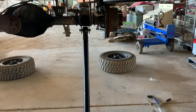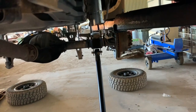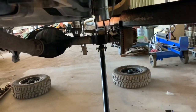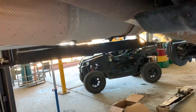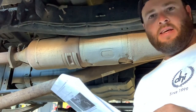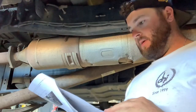This bracket's all in now. I've got this traction bar just sitting there - as I lower the vehicle I'll put the wheels back on and the suspension will take up and pull that traction bar further away from the vehicle, away from this point just here. Once it does that then I can get the bolt in and set them to where I want them. I'll drill the other side now - I think that side should be a lot easier than this side because you don't have this fuel tank in the way with the bracket. Make sure you read the instructions for each part.